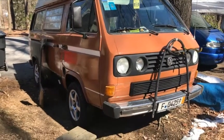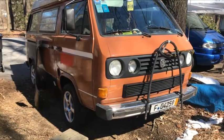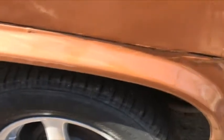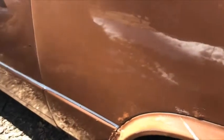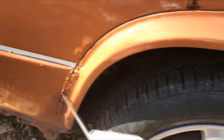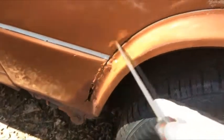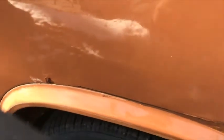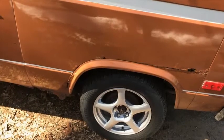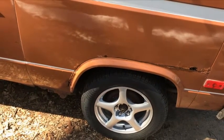So you can see what this looks like now — this is two pieces. We're going to be replacing this; it's a bunch of welded pieces in here, but every time I fix it you can see what happens. What I'm going to do is cut out this entire piece that matches the replacement panel, so I'm going to replace this whole back piece as one panel as opposed to the two it originally was.